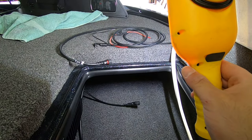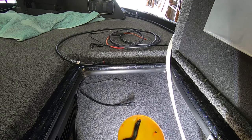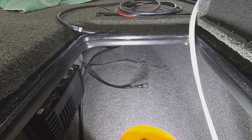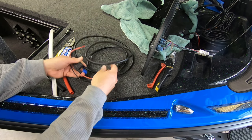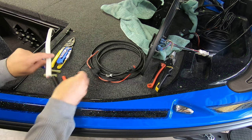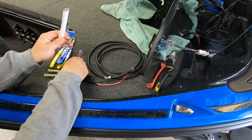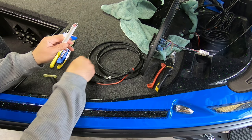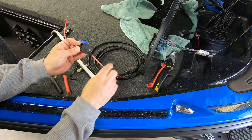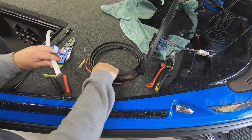I've got the power supply from Garmin here. We'll attach that to our run of power and bundle it up underneath towards the front. The Garmin power supply connects to the black box, and the spliced end connects to the run we made back to the battery compartment. I'm going to splice this using inline crimp connectors, and we'll use the inline fuse that it comes with since we don't have a fuse between this and the back battery compartment.